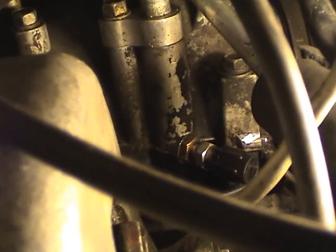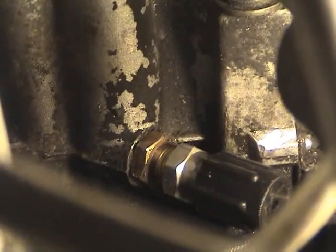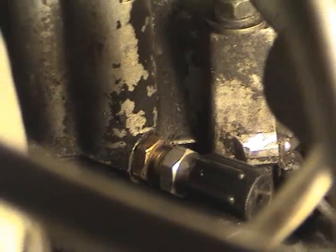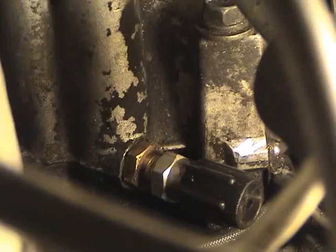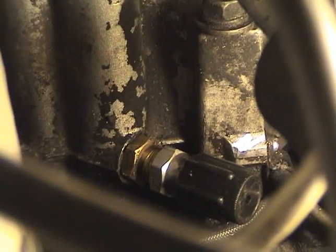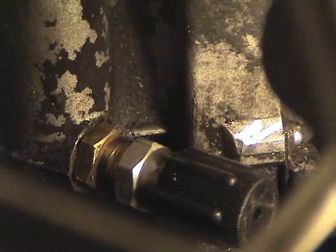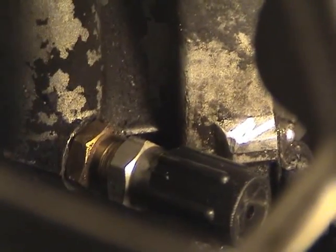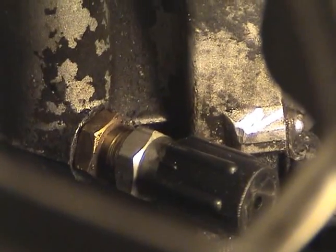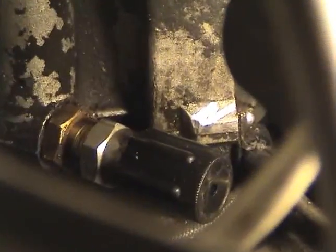This is the low-pressure valve on the compressor. You'll see the stock brass fitting on there with the Quest retrofit piece. What you want to do is remove the valve stem from inside your old brass valve, and then the new part screws right onto your threads. You just want to do it hand-tight, otherwise you'll crush the O-ring and it won't seal. It does have some adhesive on there to lock the threads, and it has a brand-new valve inside. There's also the black low-side cap.